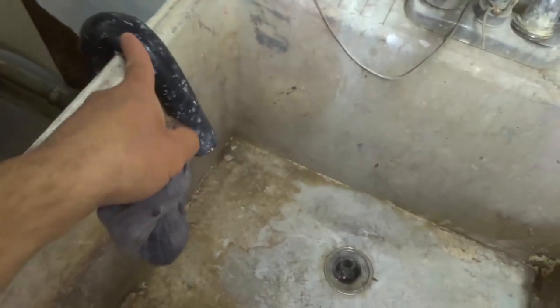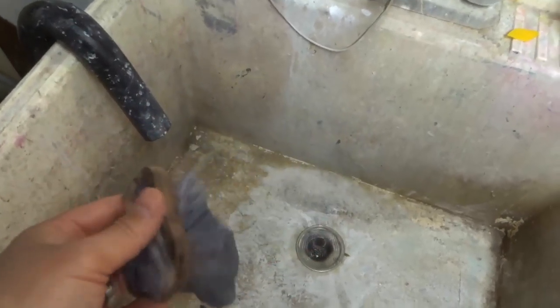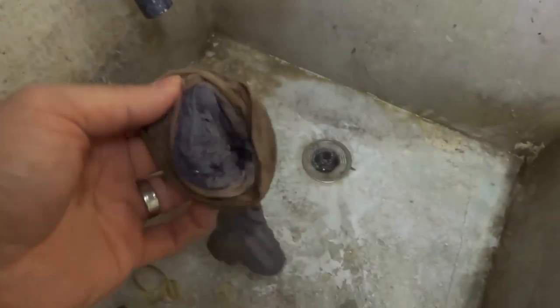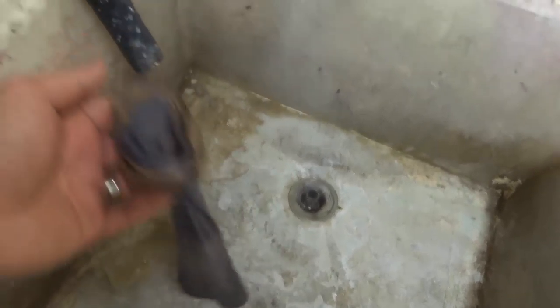So if you have a washing machine drain pipe that drains into the sink like this, what I recommend you do is do this. You need to empty it — you can't just leave it on there for years. When you have to empty it, get all of the lint out, rinse it, make the pantyhose look basically brand new, and attach it again.